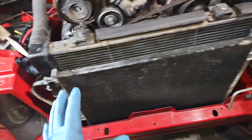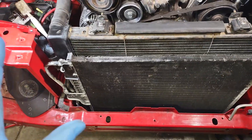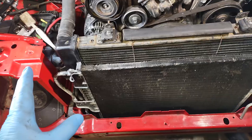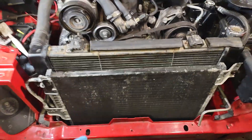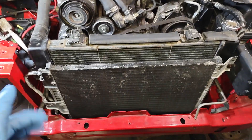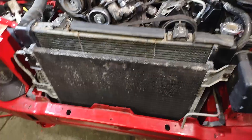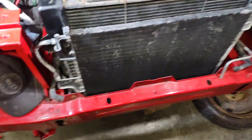Comparing — when I do have good parts still left from Burn Victim here, I have compared what I took off Hippo with what was in here. Hippo had 293, almost 300,000 miles. This only has 136,000, so I'm sure the engine is healthier. But I'm reusing the condenser for the air conditioner from Hippo, because my other one out of this Jeep — I'm sure it didn't work. If you see that wetness, that dark area of this condenser, that typically means you have an AC leak. So I bet the air conditioning didn't work. This condenser actually looks better for 300,000 miles.